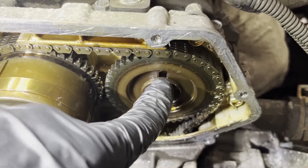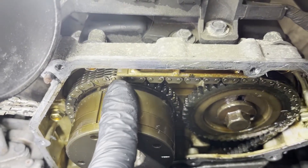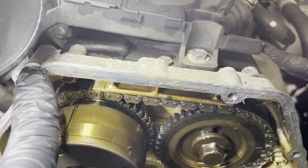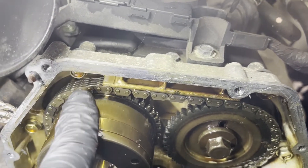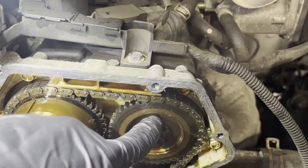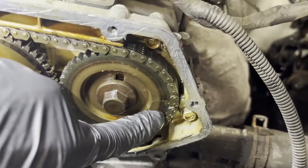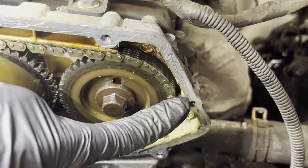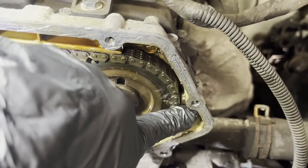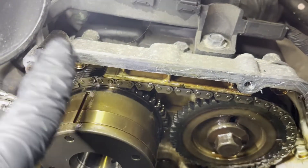This chain has skipped. This mark here has to be slightly to the left of center as well — it shouldn't be at 12 o'clock, more like at 11 — and slightly forward, not this timing cover hole, this bolt here. This mark should just be slightly ahead. And this one here should be slightly to the left. When it's slightly to the left, there's a small hash mark here that'll be roughly above this thread patch in the actual timing cover surface. So you ignore the bolt here and go with this hole. On this side, you go with this bolt and ignore that right there.